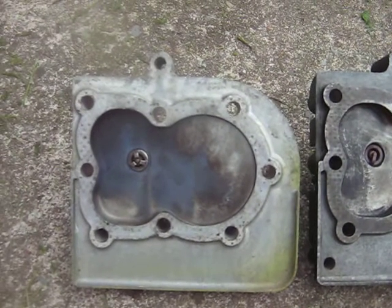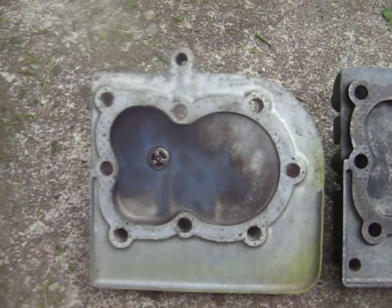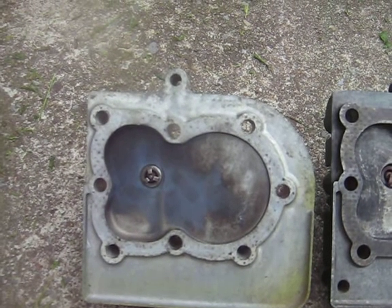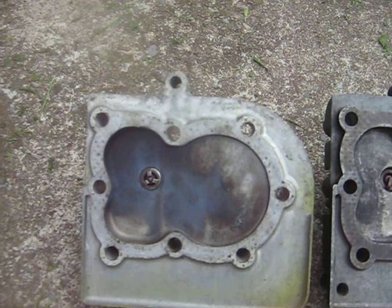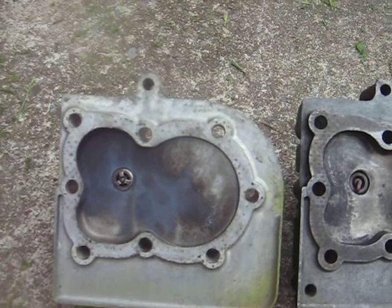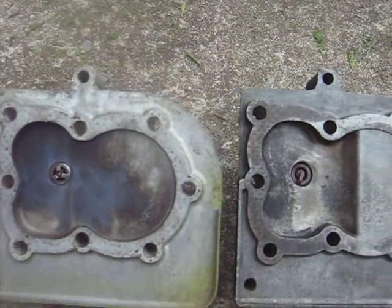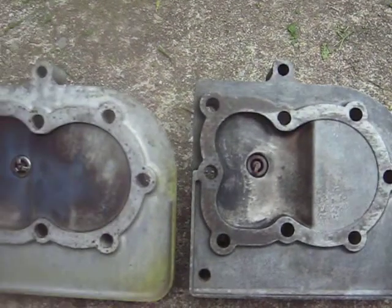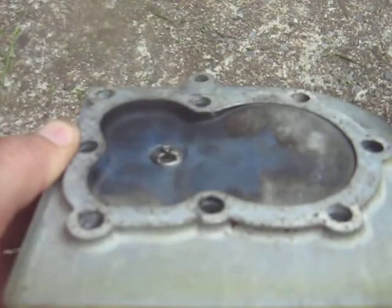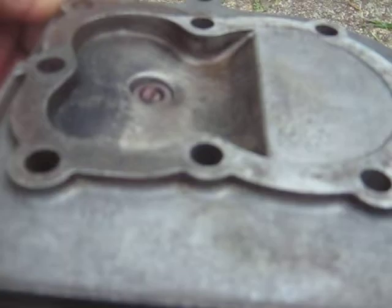It's not legal for go-kart races to bolt the four-horse cylinder head on. But the go-kart engine I'm building is going to run on gasoline and it's not going to be raced or anything, so for that purpose a person could bolt the head on. I'll just compare here and see how shallow the four-horse head is versus the five-horse head.